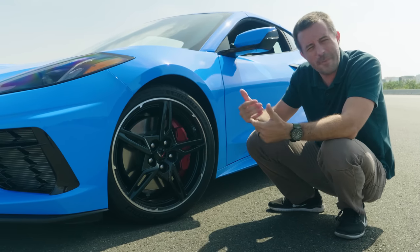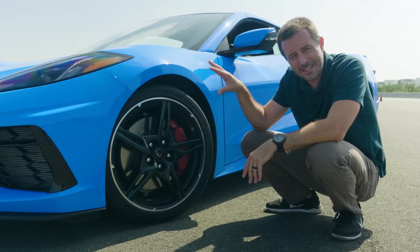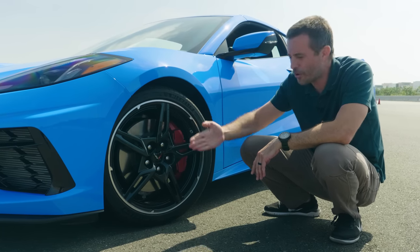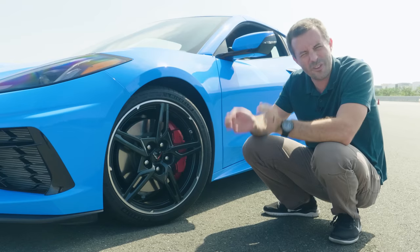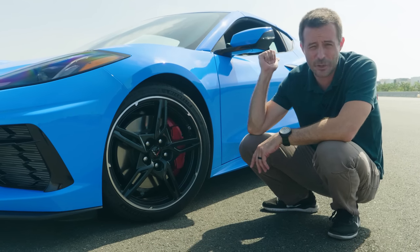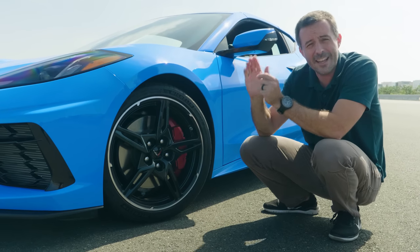On a performance car like the Corvette, you make alignment adjustments to control the handling balance of the car, because you don't really care as much about tire wear. The track alignment setting on this Corvette specifies the biggest difference with regard to camber. The street alignment setting is like negative half a degree front and rear, which keeps tire wear to a minimum and makes the car a little understeery for safety on public roads. The track alignment setting calls for negative three degrees of camber front and negative two and a half degrees of camber rear — a really big change, such that you actually have to unbolt some suspension components and remove washers to have enough real estate to make that adjustment.